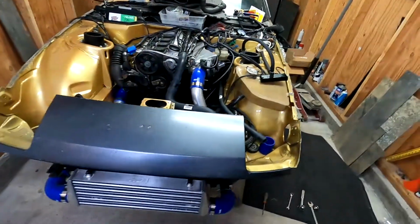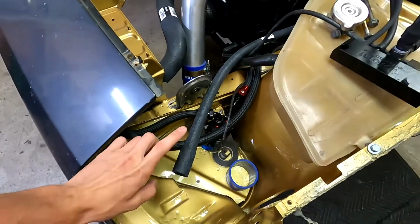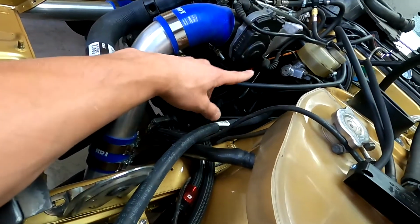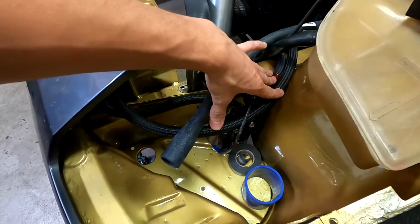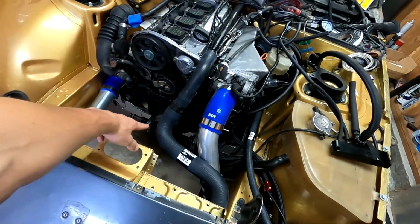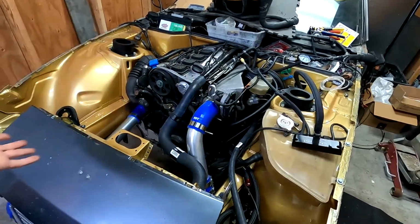With that said, the intercooler that I used for my turbo is also in the link down below. I had to get an oil relocate kit for my oil filter, because the problem is it hits the firewall. I got an oil relocate kit with an oil cooler that was installed over there, and that took care of the fact that I lost oil capacity on the oil pan when I re-welded, and it also relocated it so I don't have to cut a hole in the firewall.